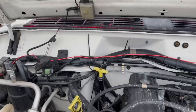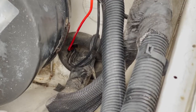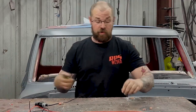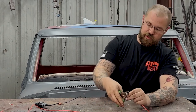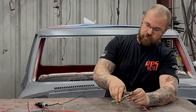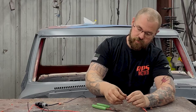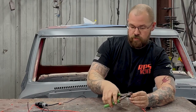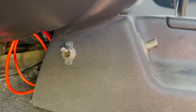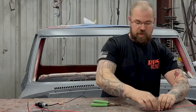But we need to figure out how long the wire needs to be — things like that. That's done and installed. Now in the middle of this wire, we want to allow ourselves the ability to turn power on and off to these lights. So we're going to install a switch right there in the middle of that circuit. On each side of the switch, we're going to install a much smaller ring terminal, and install that on our switch. Now we've got the hot wire at the battery and a switch right here.